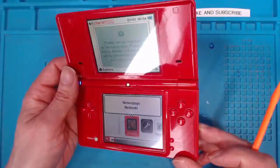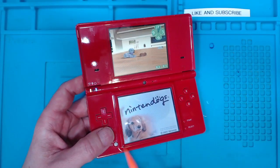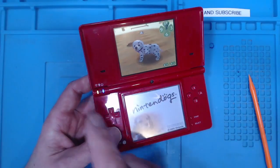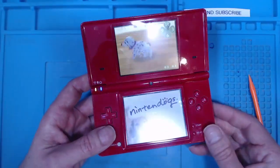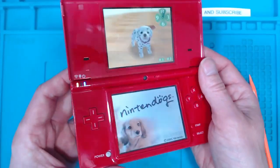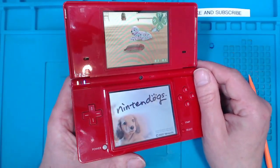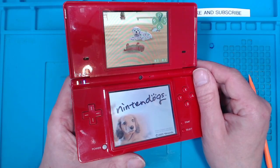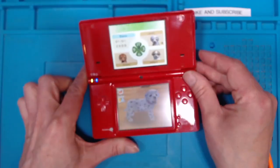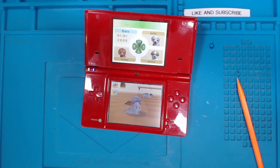So that was a broken or intermittent problem with the power switch. I took the daughter board from a spare unit, but I did manage to fix that daughter board, so it's still working and can be kept as a spare. Thanks for watching — if you've got a Nintendo DSi that won't turn on, check the power switch. Give it a good clean with alcohol, clean the contacts and ribbon cables, and if that doesn't work check continuity on your power switch. Like and subscribe if you enjoyed the video!